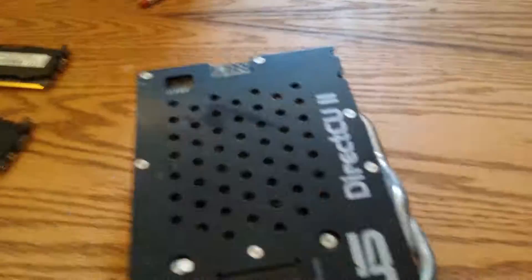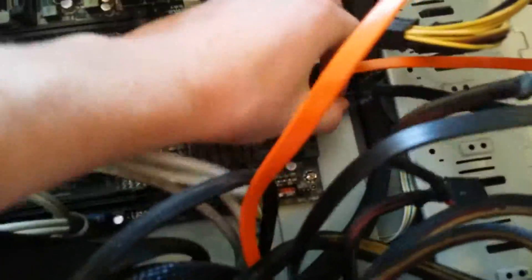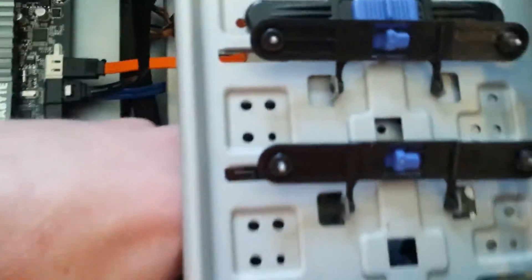So you want a good middle ground. If you don't have a can of air you can always try blowing it out yourself, but that's a little bit more difficult. We want to make sure we blow any area where dust could have gotten into — this includes any heat sinks, the graphics card, the CPU cooler, the RAM, the motherboard itself, the hard drives, all the cooling fans, and the power supply. Of course, the final step is to put everything back together and enjoy your newly cleaned PC.